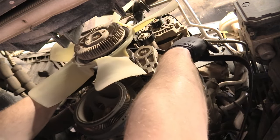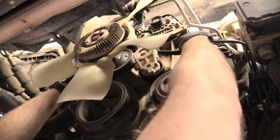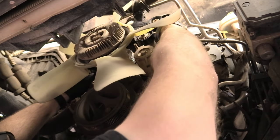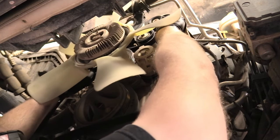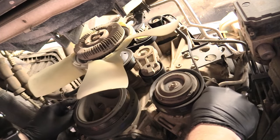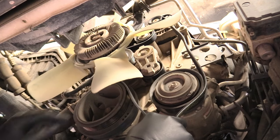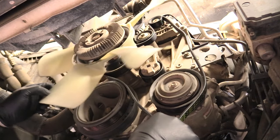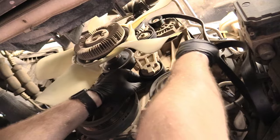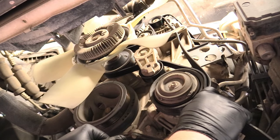Let's lasso the fan — get that on there. Then we're going to wrap the smooth part on this idler here, then it's going to go up onto our alternator like that. Then it's going to double around the radiator fan. So you get to this stage here, and this is going to go up and go like this on our tensioner. It helps to pull tension on it while you're working so it doesn't just flop off.